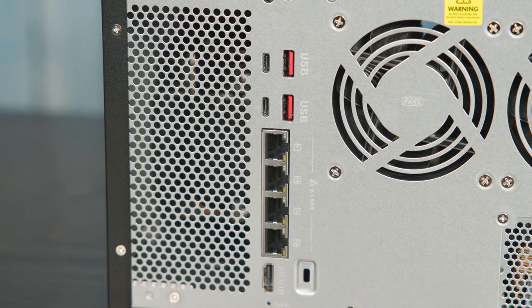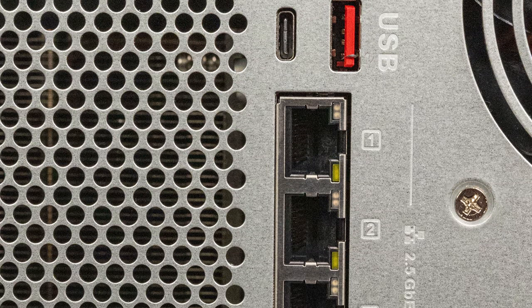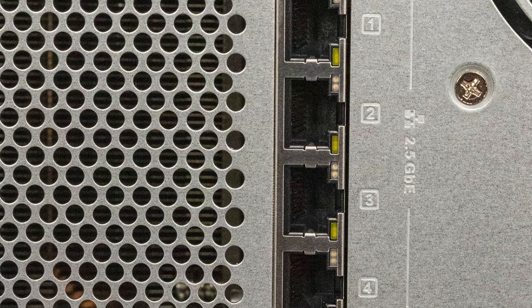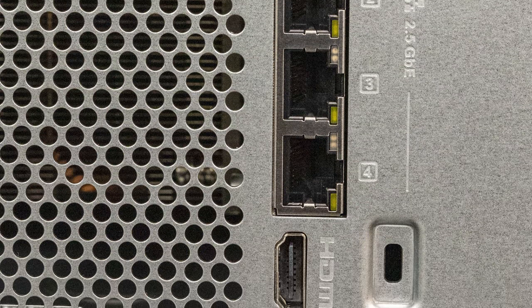In terms of IO, it's actually kind of cool. There are USB 3 ports — two Type-A and two Type-C on the back. There's also an HDMI port if you want to drive a display from your NAS. But to me, the big feature is the networking. The first thing you'll notice is that we have quad ports, which is kind of standard on higher-end SMB NAS units. But what's a little bit different here is the fact that these are two-and-a-half-gig ethernet ports — not just standard one-gig ports. If you look at something like a Synology, those tend to use one-gig ports. QNAP has said they want to be a little more modern, so they went with two-and-a-half-gig ethernet. Frankly, I think that's absolutely great.